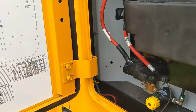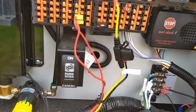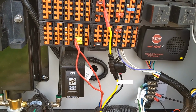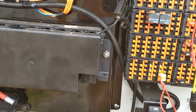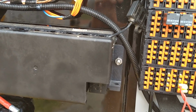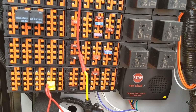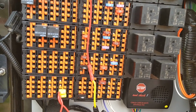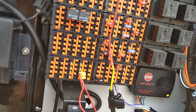And this bus has a simplified electrical system called a CAN bus system, where one wire does the work of more than one. So instead of having like 5 wires, you can have one wire that carries a signal, and it'll tell a module, hey, make the blinker blink, and the blinker will blink on the left side, say, and then the right blinker, and so on and so forth. But you can see this is so much more simple.